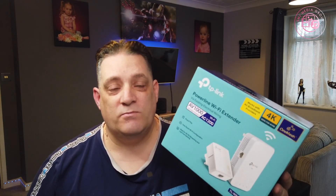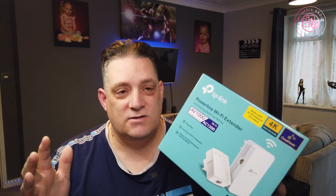A lot of people complain that their broadband speed is slower, not realizing their existing kit can't do more than 300 or 500 megabits. Some of these older ones are like that. And on the electrical cabling — a question I've been asked before — these power lines will work up to 300 meters or 1,000 feet over existing electric wiring. So these won't be great for large business environments where you're going from one end of a building to another, but they're very good for home use or small offices where rooms are close together.